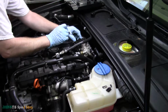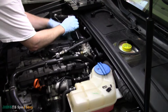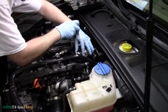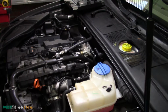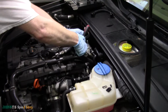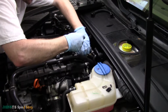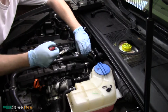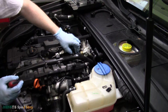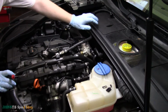Grab yourself a little pick. You can pop off your connectors. This thing's pretty hot. I did not realize it was this hot. Oh, he's hot. This guy doesn't want to play ball. A lot of times if you get a connector that doesn't want to come off, shove it back in. Push it further in and then try and take it out. It'll release that little plastic clip that's inside it. Top tip on a Saturday.